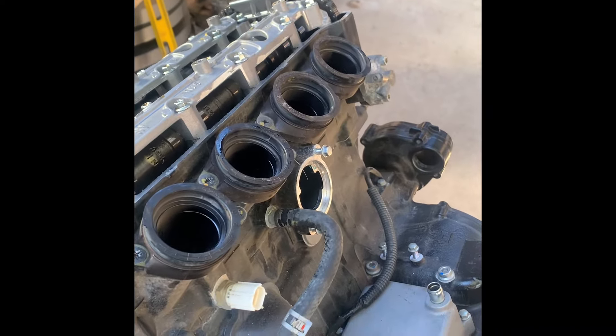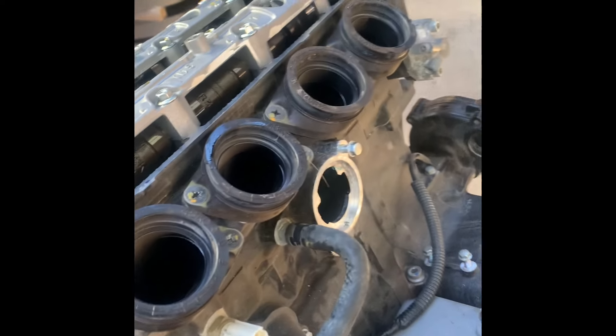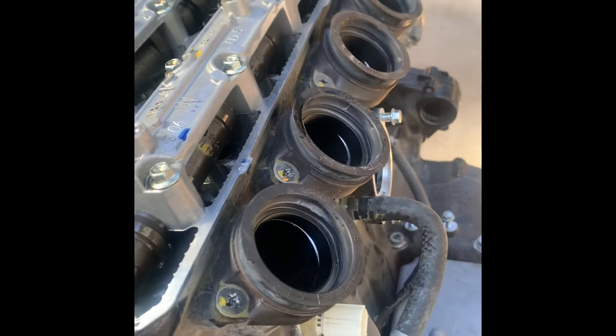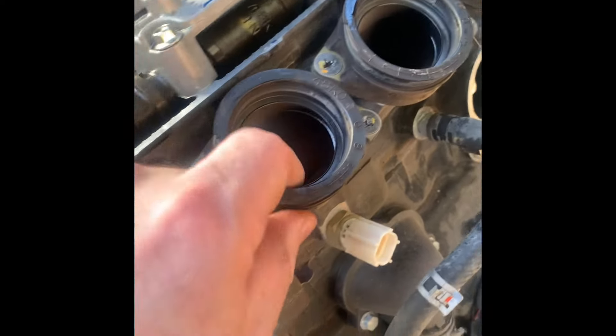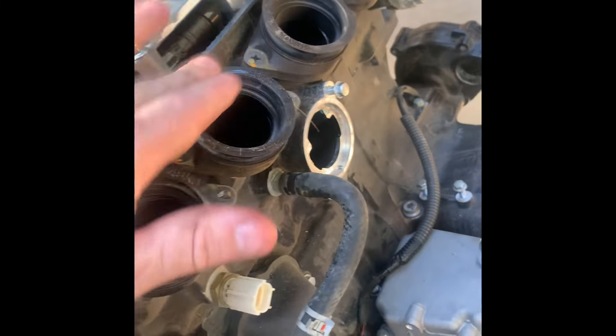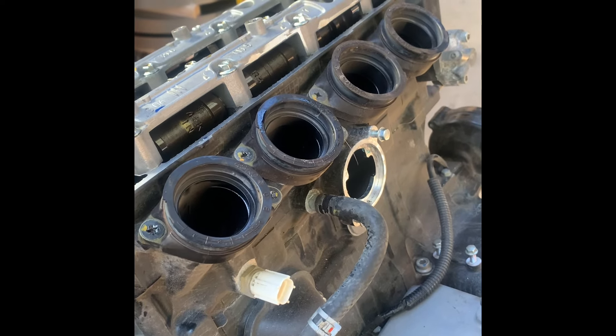One small difference with this newer S compared to the older S: the rubber inlets seem to be smaller. So whilst the throttle bodies line up, the actual throttle bodies themselves don't fit in. But you can transfer the GSXR ones across and they'll just bolt straight in. These inlets seem to have been reduced quite a bit on the later engines. On the last engine we had I retained the older inlets and the throttle bodies fitted straight in. Swap those over and you can fit bigger throttle bodies, which is great news.